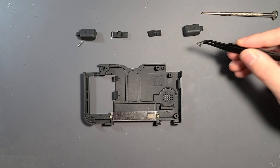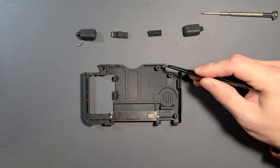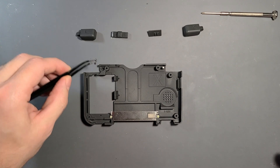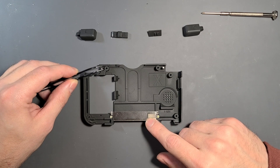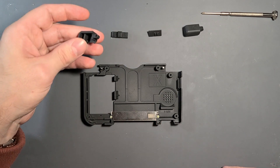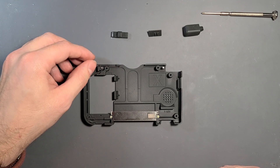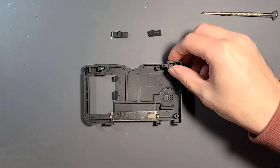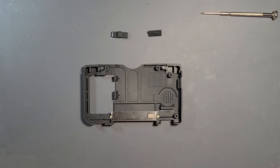I'm going to work on the shoulders now. In the original DS Lite there are springs that go with the shoulders to help them retract after you click them, but we will not be using those — we just need the pins from the DS Lite. Seat those in the pin holders, and the shoulders just slide on. Make sure the shoulders are seated correctly within the shell; they should sit basically flush.